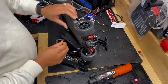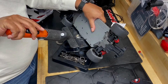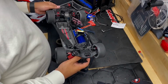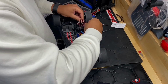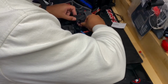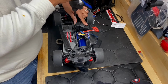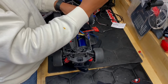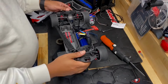First, we're going to reattach that wire cover on the bottom. Okay. Next thing we're going to do is attach the cover for the receiver. And I will once again point out, you see how lightly I hold my power screwdriver? As soon as I get any resistance, it spins right out of my hand. The reason I do that is I want to ensure that I don't strip any of this plastic. Okay, so we have that all done.